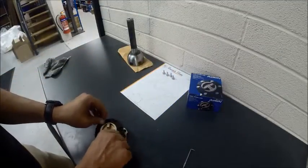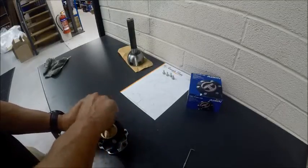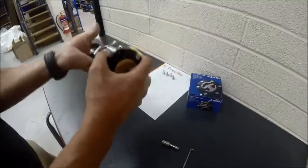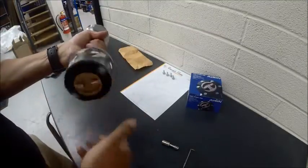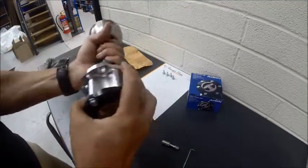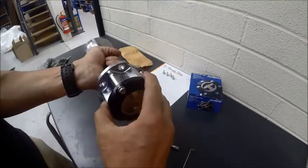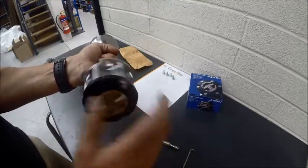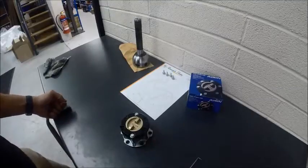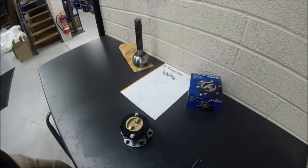We're just going to put the bolts in. In the free position with our drive shaft, it's spinning nice and freely, no clicking noises. Engage lock — hear it click in — and we have permanent drive to the hub. Disengage to free, you can hear it unlock, the main spline is pulled back into the cap, and we are free. Hopefully that will help you to at least inspect your hub rather than having to buy a new one. Well worth pulling apart, spending a little time looking at these components and seeing if you can get away with rebuilding. Thanks very much.